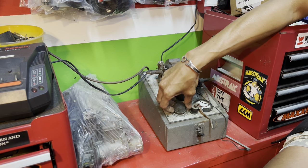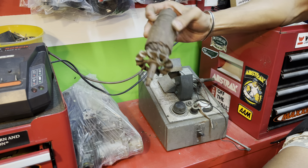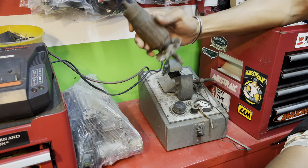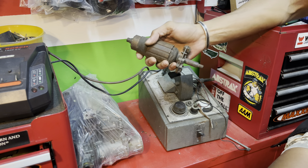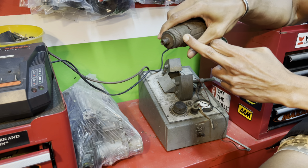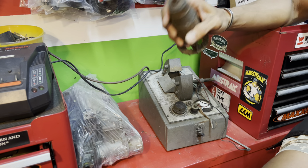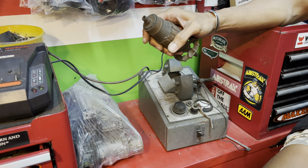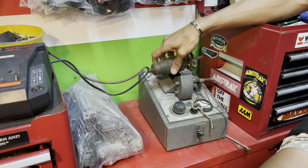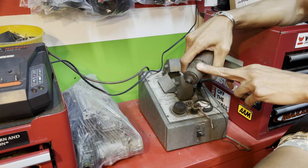Most workshops that worked on British motors would have this tool. What they would do is open your dynamo, take out the armature, and rewind the copper wire inside. There are two ways to rewind the copper inside: the first way is using a machine, and the second way — the way I prefer — is rewinding by hand. Why? Because when you rewind by hand, the winding from one wire to the next becomes tight, tense, and neat, because you can feel the tension. It takes a long time, but the chances of error become very low. However, this requires practice — over time, if you've done it repeatedly, you can estimate the tension needed based on the thickness of the copper wire you're using.